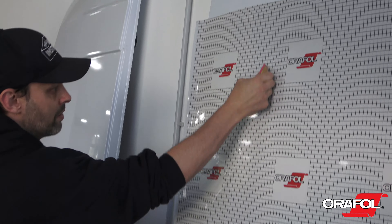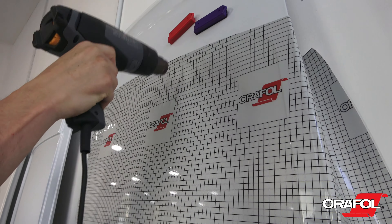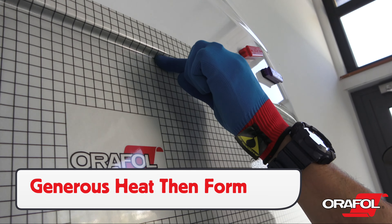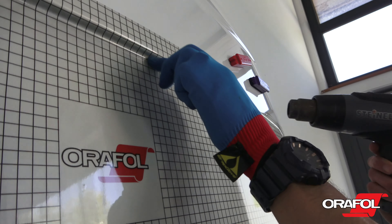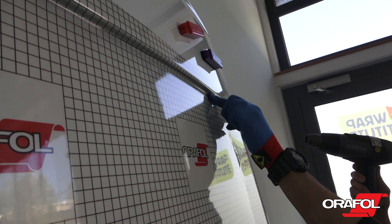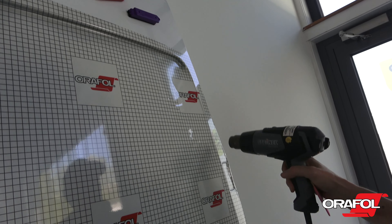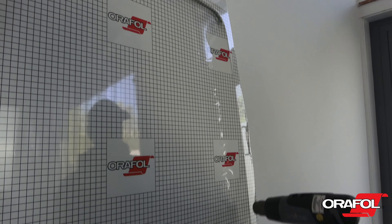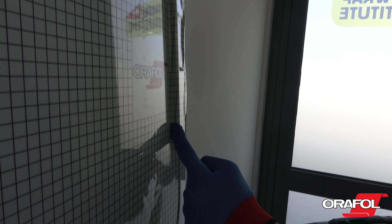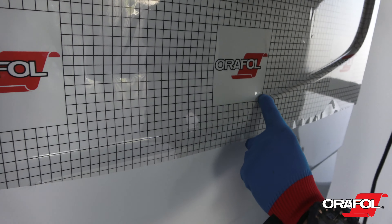For the top section, warm and form the film to the cutting tape, then release it in the standard manner. For mirrors, be sure to avoid distortion when stretching. A good way to do this is work with two installers to help spread the tension out evenly. Trim line tape was laid down on the mirror so the installer can cut the excess film away cleanly with a knife. Note that mirrors should be wrapped in two to three pieces based on the shape and angles, with the back piece holding any stretch from the main piece.